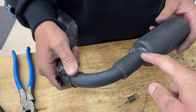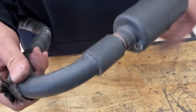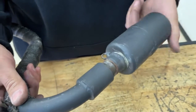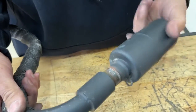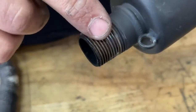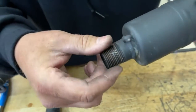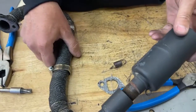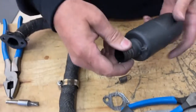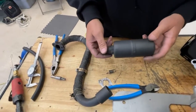What about the threads? There are peaks and valleys in those threads. It's not going to tighten up to the last couple of threads. On a sandpaper wheel, you could sand some of the tops off of that pipe. It's still going to be a half turn from hand tight, but more air will get through it. You have to be creative and within the rules, because the rules are — you can drive a truck through them.